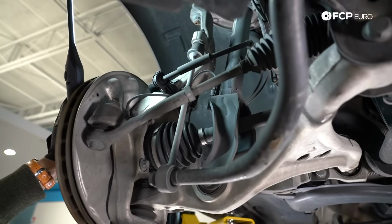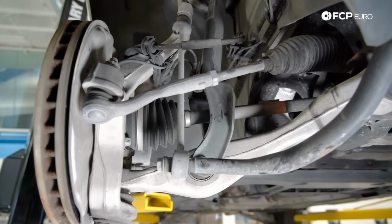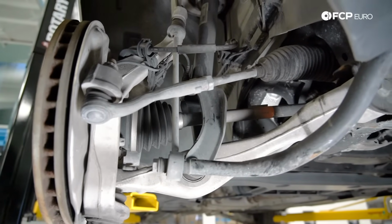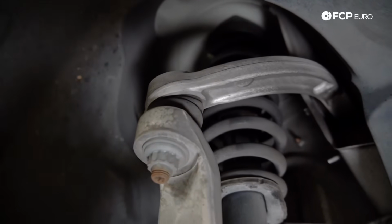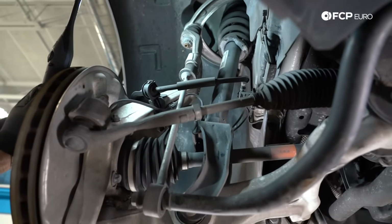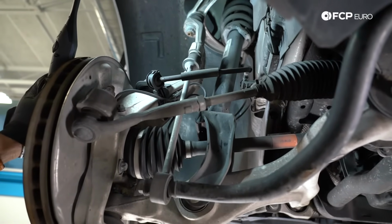All right, so when it comes to the suspension, you've got a double wishbone front suspension on all of these vehicles. If you've got a GL, GLS, one of those models, all of those had air suspension, so the strut's going to look a little bit different. You're not going to see the exposed coil spring. Most of your MLs and GLEs are steel suspension. There were some that were optioned with air. A good example is like an ML AMG model, had air, standard.